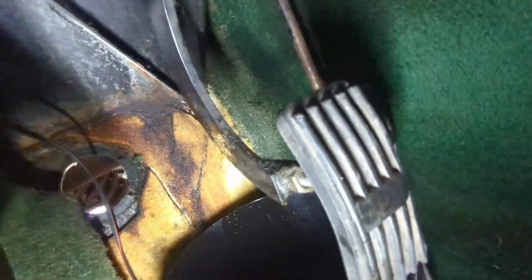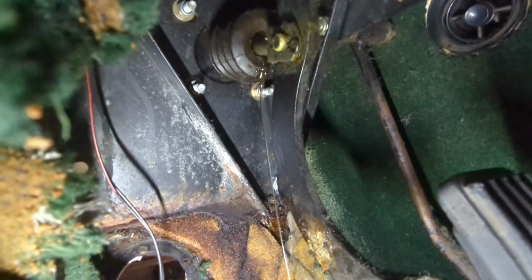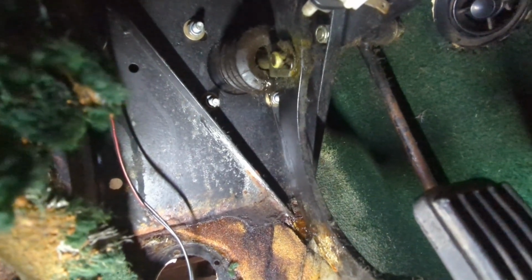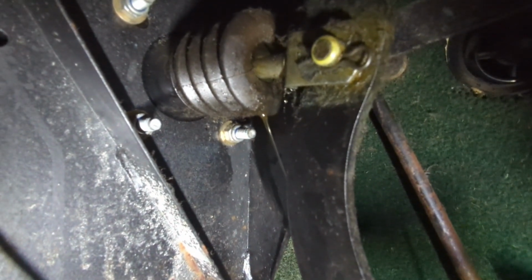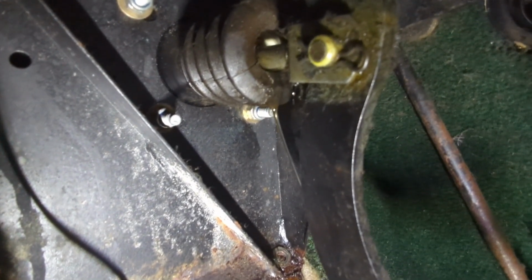And I think we can find out pretty easily what was wrong with this. So if I press this brake pedal very slightly, it's absolutely pissing out the back of the servo into the bucket, obviously. So it's obviously got a failed seal inside the master cylinder, leaks straight into the servo. As soon as you press the pedal, it's opened up a gap. That is where you don't want to see fluid coming out at the end of your servo. So yeah, I think we're definitely best changing servo and the master cylinder.